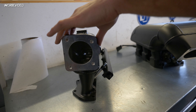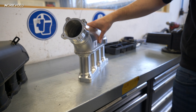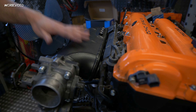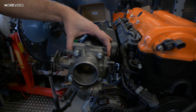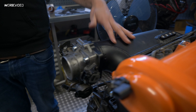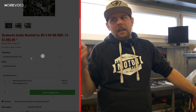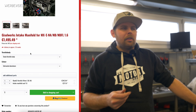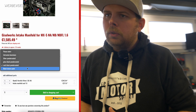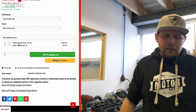We have a manifold for the 1.6 liter NA and NB, for the 2.0, 2.3, and 2.5 liter NC, and for the 1.8 liter NA and NB. We have all the manifolds with different flanges, which means you can connect to an NA or NB 1.6 or 1.8. You can use the standard NA throttle, the NB throttle, the NC drive-by-wire throttle, or the Skunk throttle. It's just a dropdown in the webshop and Sebastian will add a shortcut so you can find it easily.